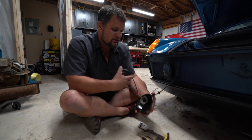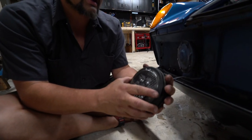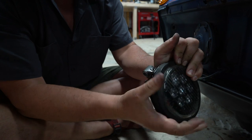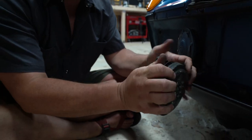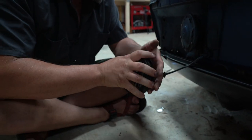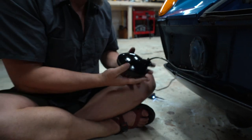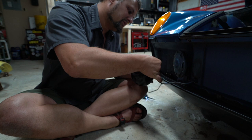And so then what you're going to do is wind this wire into the back housing. Make sure you line up the top with the top. I like to hook it on the top first, line up this little notch in the bottom. And then if you have everything lined up correctly, it should just snap together. You have to use your screwdriver to push on a little bit. And then you'll be all back together, and at that point, you can deal with your grommet and getting this back in place, and then we will bolt this guy back down into its stock home.